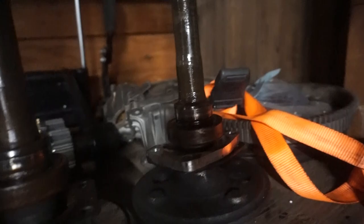So I pulled both the axles out and they look to be in good shape. None of the splines look like they have any warping on them. You can just see all the rust build up on the race and bearing, more than likely from it being married to the axle housing for the past 30 years. The bearings still spin and they don't seem to have much of a wobble to them, but I'm still gonna swap them out, just because it's one of those annoying things to get to, and since I have it out right now, might as well get it pressed out.